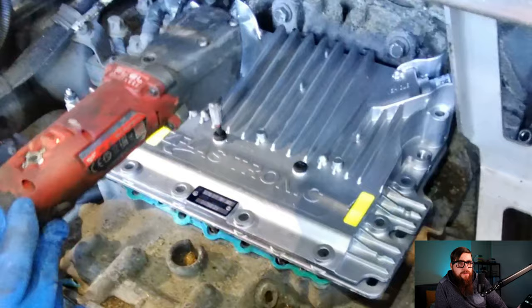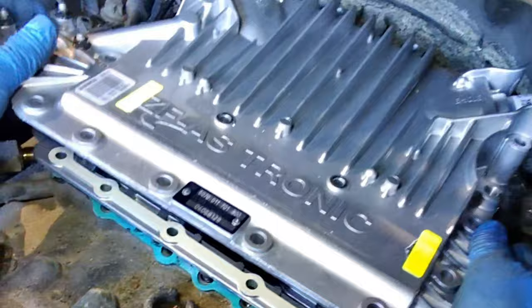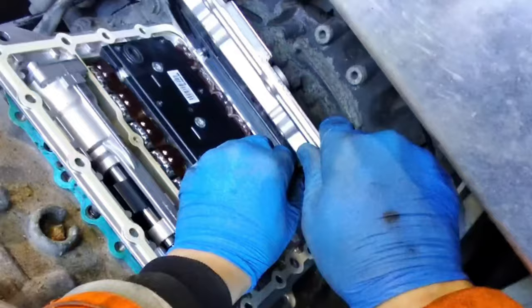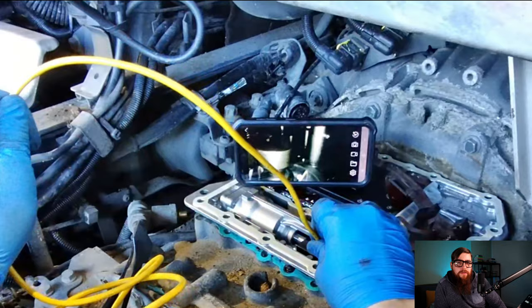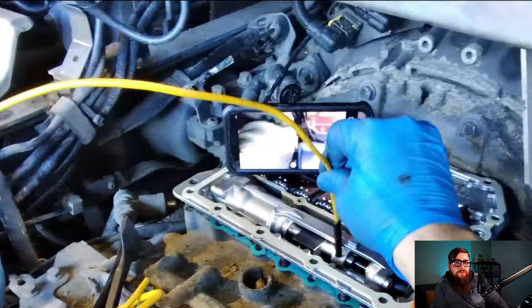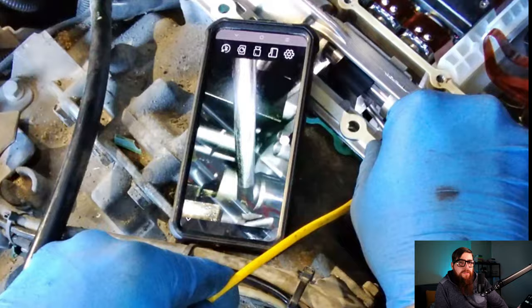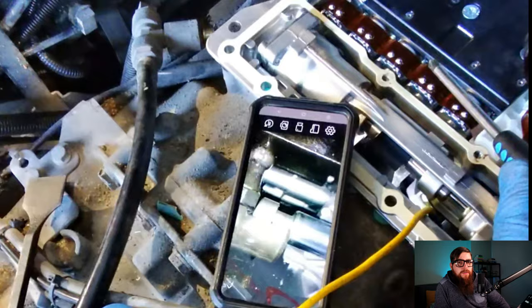We can whip these two bolts out of the lid — try not to lose them — and then carefully unplug the ECU ribbon cables from the modulator solenoids. This bore scope is awesome: connected to my phone via WiFi, it not only has a camera in the top but also one in the side, which you can use independently or at the same time — not to mention take pictures and record straight to your phone. I can easily identify all three pistons, and we had two out of three lined up. We just have one piston to manipulate into the right place, and for that we can use a screwdriver and get the lid to drop on. With me visually confirming all of them are in, we won't have any worries about bolting this all back up and wondering if the gearbox will drop into neutral.